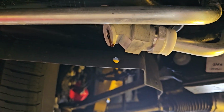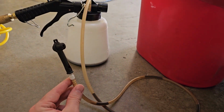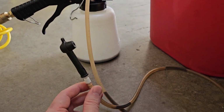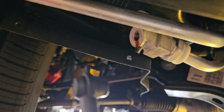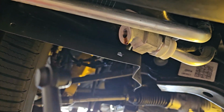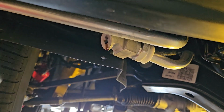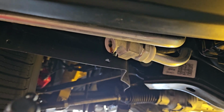This thing just keeps on dripping and dripping forever, right? Well, we use a pneumatic bleeder. Link to buy this pneumatic bleeder in the description. It's about $30, $40. And if you've got a little air compressor, which if you're working on your own car, you probably do. You can see how much I've already bled out of there. You just stick this nipple and hold it up there on that opening, and you'll be like, wow, there's a ton of oil coming out. So you bleed and bleed, and then take it off, let it drip some more, bleed it some more until you're only getting one drop every probably 5 seconds or so. Then you can clean the threads, and you can put your Fumoto valve in there real quick.